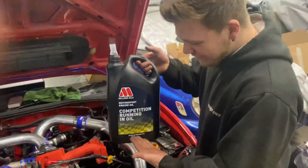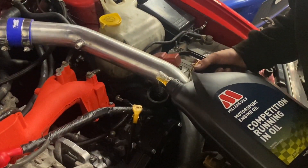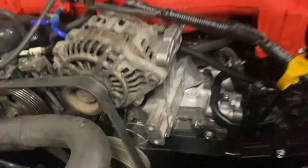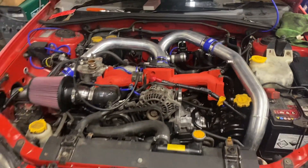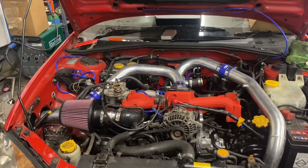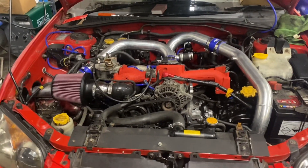Using Miller's running-in oil — free advertisement. Oil is all in. The crank sensor needs to come off so the engine can be primed — pumping oil around it before it starts up, otherwise it might ruin the engine. Passing the phone to Cora now to try and start the car.